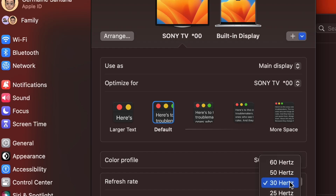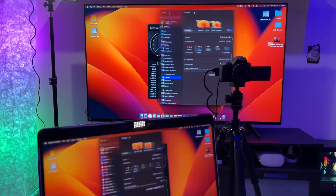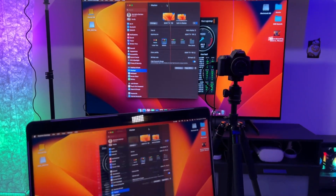Connecting to my external monitor at 4K 30, I was getting the rated speeds via the HDMI ports. If you have a display utilizing DisplayPort, you will get 4K 60, no problem. There is roughly a millisecond or so of delay between the MacBook input and the external monitor, and you will see and feel that slight lag on the external display.